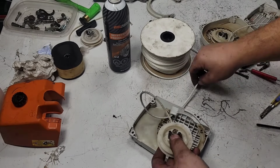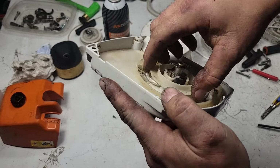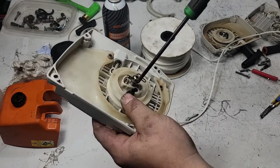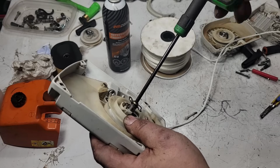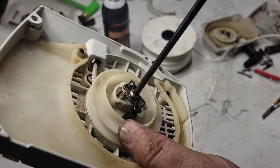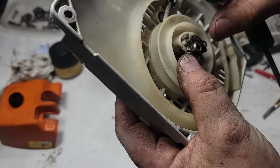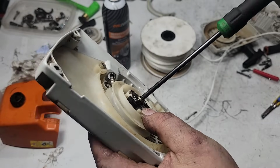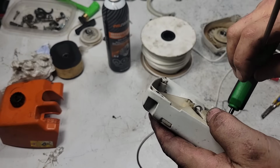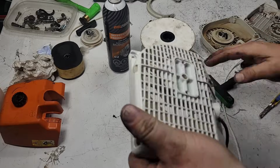Okay, now don't worry about winding your spring. Just figure out where the opening is. Okay, that's already grabbing the spring. Now take your Torx and start winding it in. Okay, make sure your starter dogs or paws, whatever you want to call them, make sure they're grabbing. Okay, now cinch it down tight. These things factory are usually so tight, they're hard to remove. Okay, so don't be afraid to reef on it. Okay, tight.